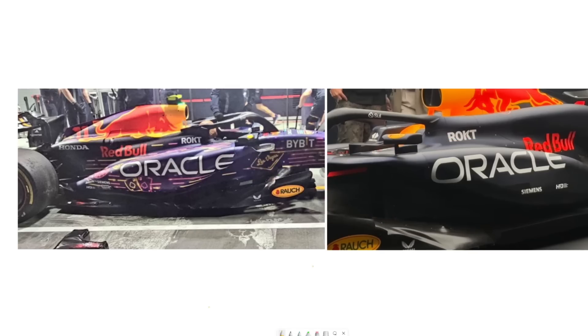There's also the outboard shift of pressurization we talked about earlier, where you can move that pressure sideways. And as I speculated in the Ferrari video, this vertical inlet would bleed in some of the boundary layer running alongside the monocoque. That boundary layer would result in reduced cooling performance because you'd have less energy at the inlet, but it might clean up the flows through this undercut region that go around to the floor at the back, which could be quite an advantage.